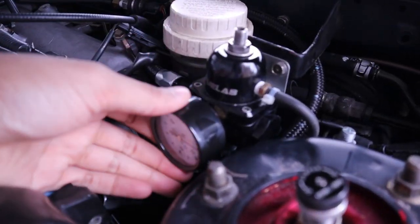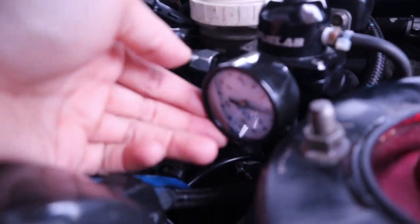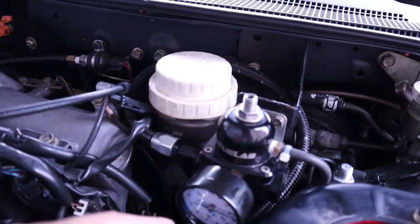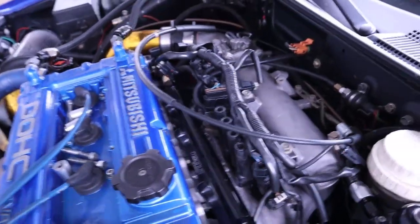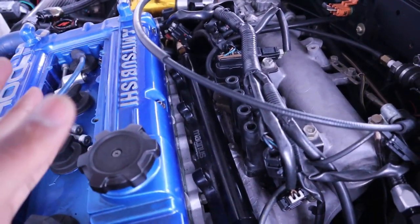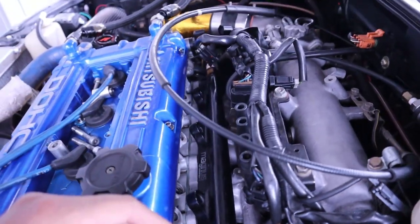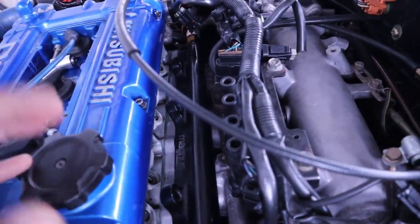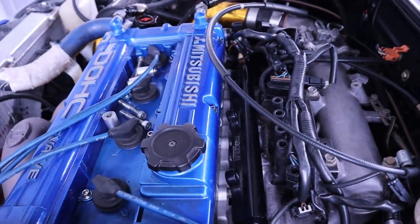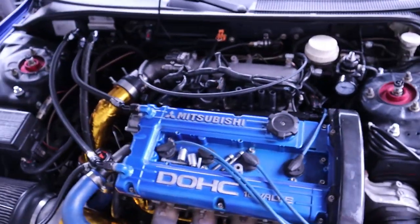I'll show you why we're not driving it right now. I put in a manual fuel gauge — I had a wired one inside the car, but Tyler who's helping me tune noticed the pressure seemed high on pump gas — around 45 to 46 psi. We haven't tested it properly yet because my fuel rail is completely loose. I was trying to fix a minor seepage on one injector after replacing all four less than a month ago, and I pinched two or three of the top o-rings, completely ruining them. I ordered a new set — an Amazon o-ring kit didn't work because these need very specific o-rings. There goes $60. But hopefully once I get those in we'll go for a proper drive and fix the pump tune.